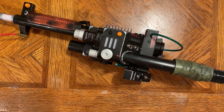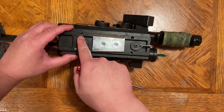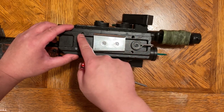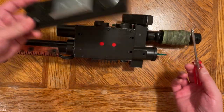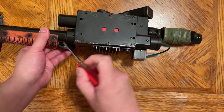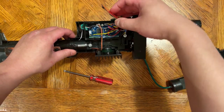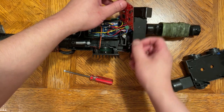There are going to be two methods you can choose from, but before we get into that let's open up this wand. Quick recap: you're going to have to screw into four plugs in here and rip those out, then unscrew four screws underneath. Then here you've got another four screws — one here, one here, one here, and one here. Next you're going to take off the wave trigger. You can probably push it aside, but it would be easier to work with if you just unplugged it completely.